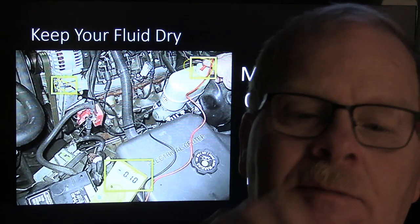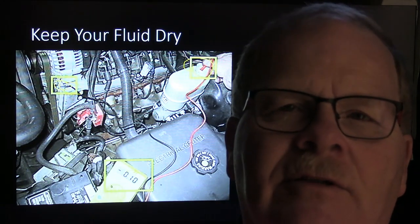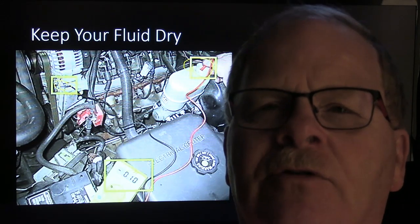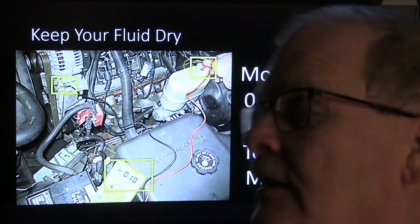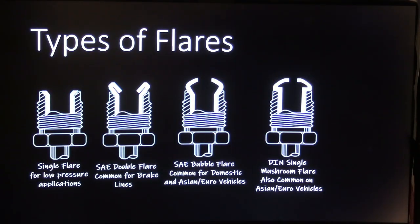And I've actually done brakes before when I felt something and said, well, no, that's not right. I know there's no air in it because all I did was replace the rear shoes. And then I adjusted the rear shoes out to where they're really tight and close to the drum without actually slowing the drum down, and then I got a good tight pedal. So there's a lot of little nuances on this. There's a whole lot more to it than just swapping out the parts. You've got to know how to make all your adjustments, particularly on drum brakes.